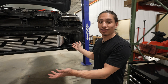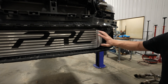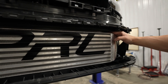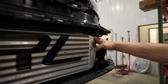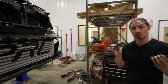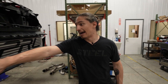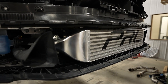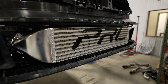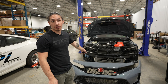We've got the intercooler on the car — you can kind of see the guts of it and how it all works. This intercooler is basically as big as we could have possibly made it. Literally, if we had made the core any taller, the welds would hit the bumper beam. It's as far forward as we can possibly have it, which is why we're using the rubber sealing strips against the bumper to act as an air dam. You can see the gorgeous billet end tanks — overall really happy with how the design came out.